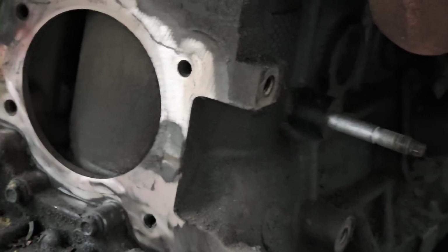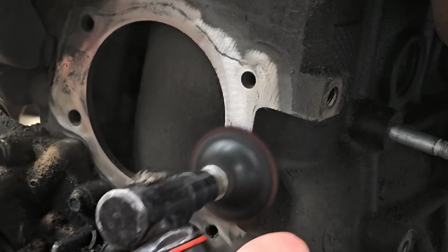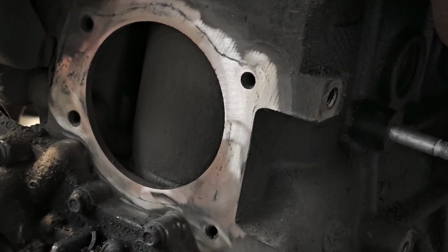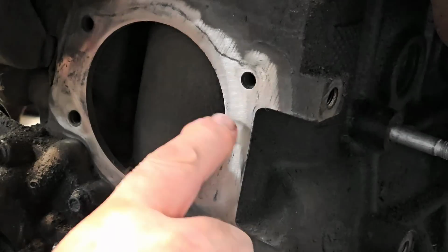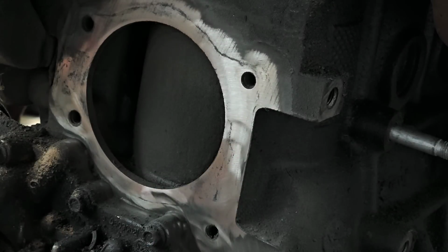So, all right. Now, unfortunately, I can't do anything about the noise. There you go. As soon as you're done getting the gasket off, stop. You don't have to keep going, because a Roloc disc, even if it's dull like this one, you can create divots in the metal. So you want to avoid that. Let me get some brake clean so I can wipe that all off.